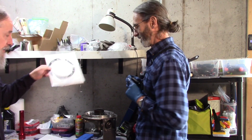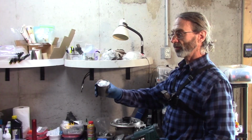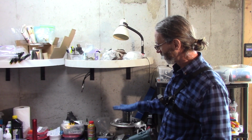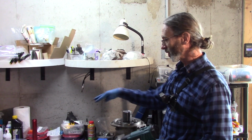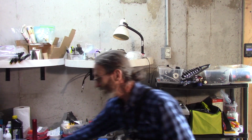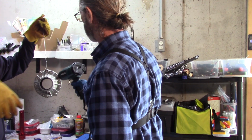So we put the gasket on. Orientation, as you see, there's space differential here. We're using this can. Just slip it over the spline. There's a seal over here that's inside the cover. Because when we put the cover on, it slides over top of the spline, so you don't want the seal to be damaged. This doesn't have to be super hot.